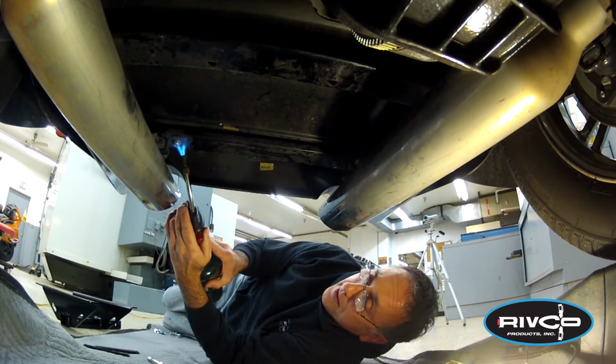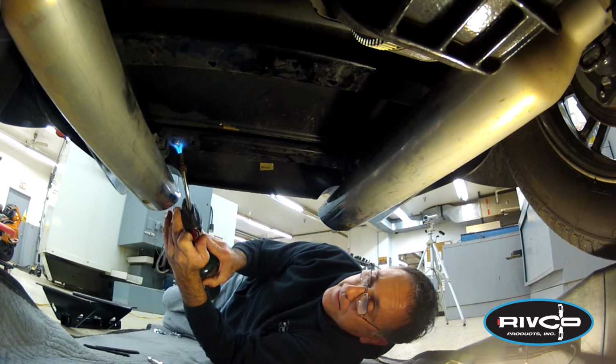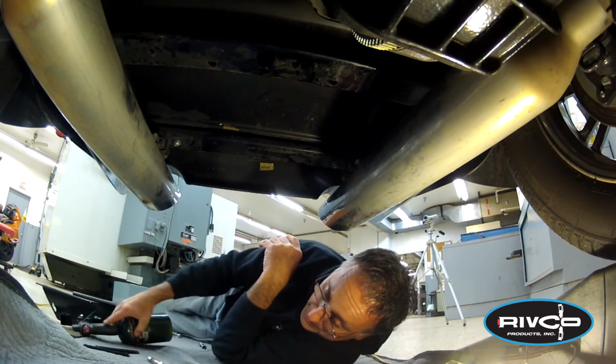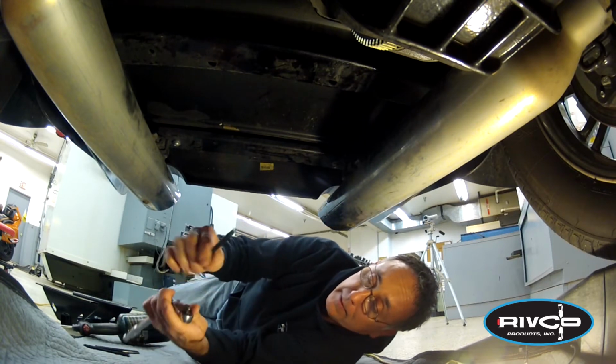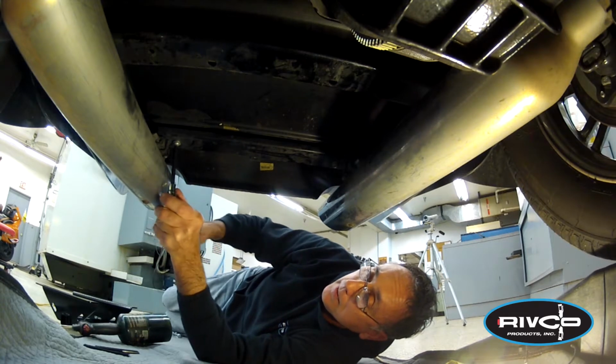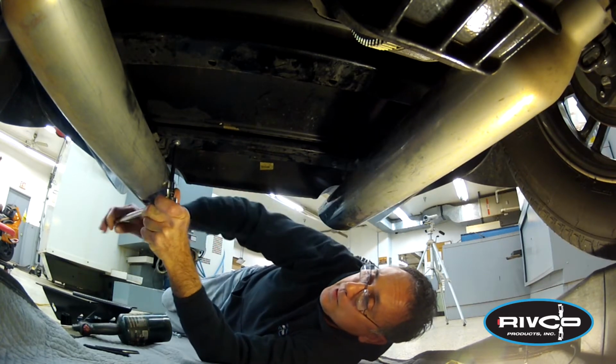You're not going to burn anything else on the bike. You can point away from the bottom of the plastic on the trunk back there. This is just a little hotter than you can hang on to. It takes about 150, 175 degrees to break down that Loctite. You're going to see a little bit of smoke coming off of that maybe, and that's fine. You've got a minute or 2 to work with it here. Put your socket on your ratchet or use your L-shaped wrench, and you can see once you've got that, it comes loose pretty good there.